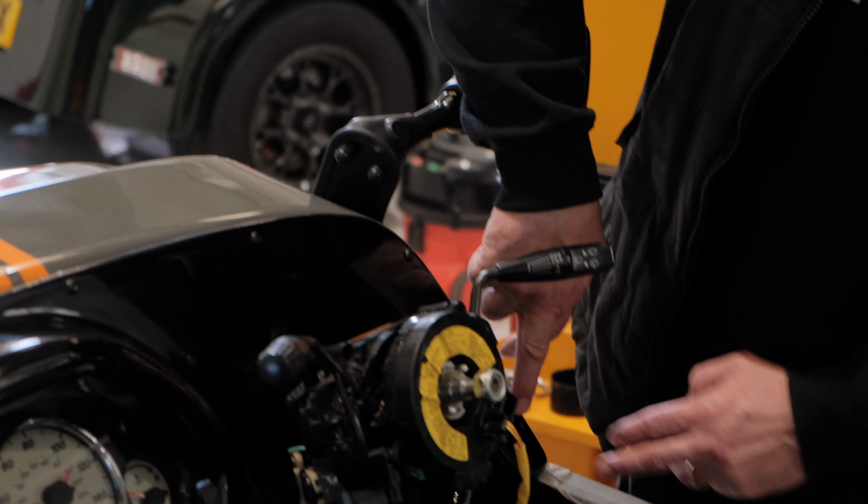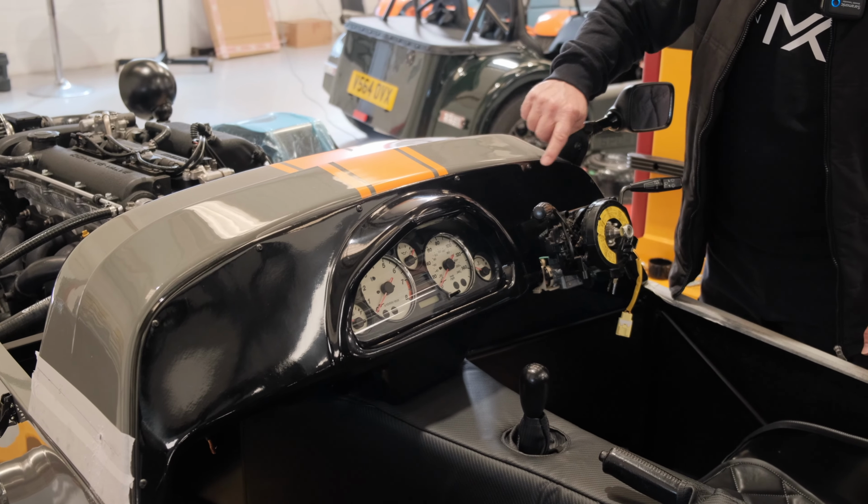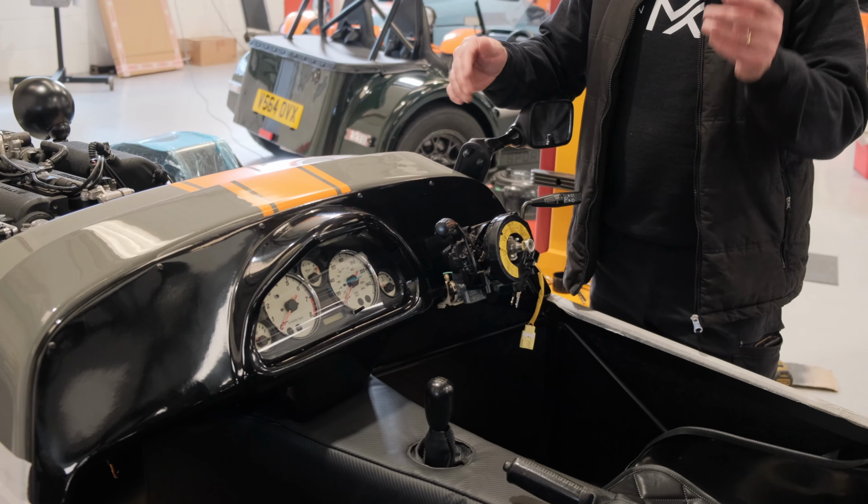All looks nice and neat and tidy and balanced, shall we say, and you don't end up getting right into the corner. If you get right into the corner here, it can be a little bit tricky getting it in and fitting and causing stress on the dashboard as well. So once you balance it out, remember it's the centre line of the dash there, 100mm either side, and then 170, 170, 170. That is in the manual as well.